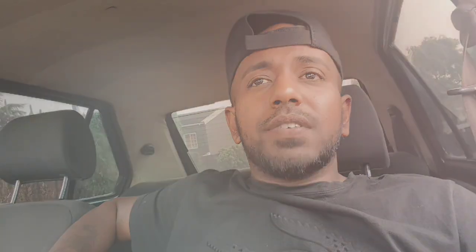The engine does have some life left in it, so I was contemplating whether to try to reduce costs. Number one piston — I'm going to show you on the block — is actually scraping the bore on all sides and the piston also has a lot of scraping damage. My friend has a spare engine, so maybe I'll just take out one piston, check the condition, slap it on this car, sort the valve seals out and run like that until the motor finally fails. These Golf 1 engines are quite cheap, so it's pointless spending money on a rebore, complete pistons, rings, bearings and everything.